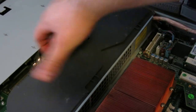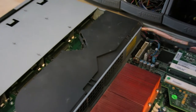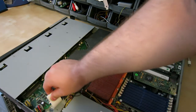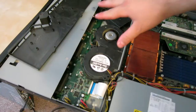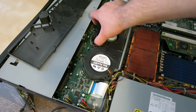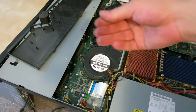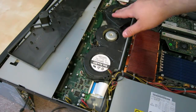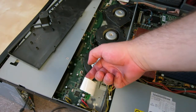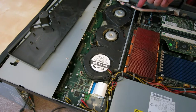The front has a second board covered by a huge shroud — I'll break that off later. This has four hot-swappable SCSI drive bays with a little flat flex cable running to the front. With the shroud removed you can see three gigantic blower fans, all made by Sanyo Denki, all gigantic and all incredibly filthy. There's a rather large control board for the four hot-swappable SCSI drives, a ribbon cable running to the front LCD, and a small SCSI cable running from one board to the other.